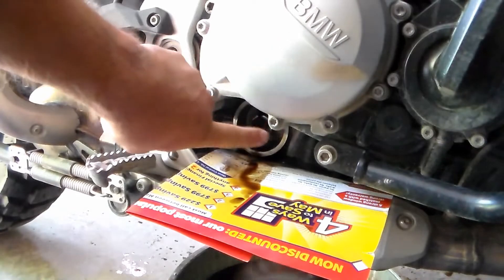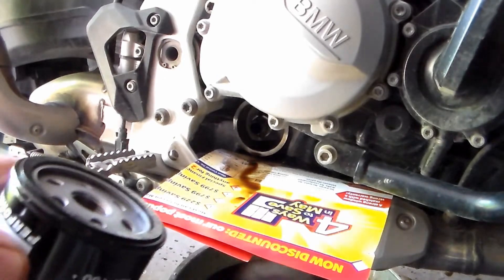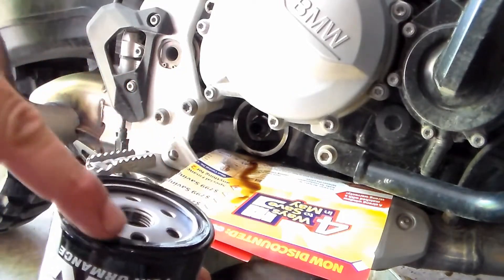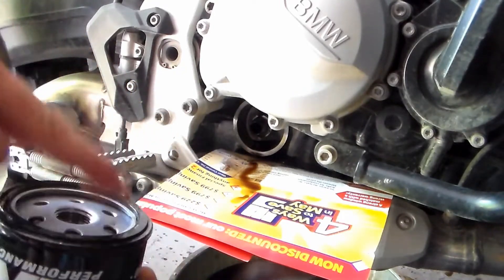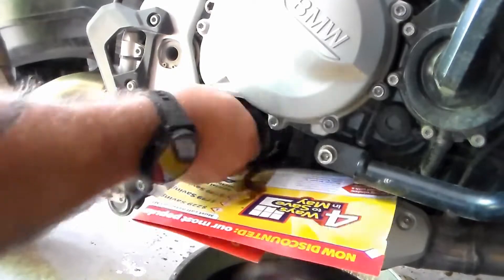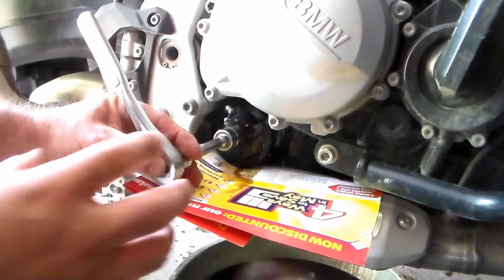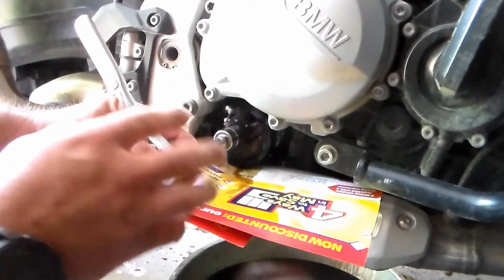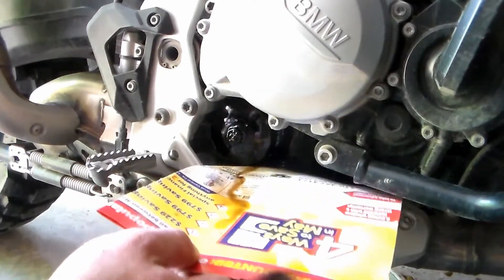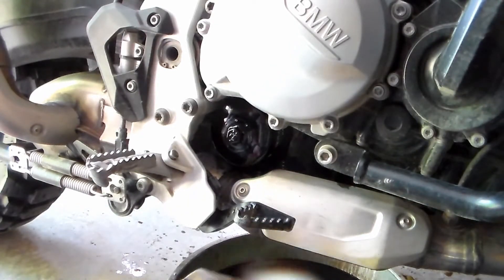Make sure you see shiny metal where the old oil filter was. Make sure the rubber gasket's not still on there — if it is, pull that off. You don't want a double gasket, the old one plus the new one. Put a thin coating of oil around the new gasket so that we get a good seal, and go ahead and install the new oil filter. Just snug it down pretty good — you don't need to go crazy on it. Once that's done, go ahead and get our junk mail out of there and thank the local car dealership for their support in supplying us the junk mail.